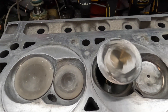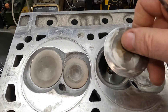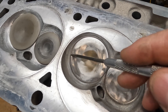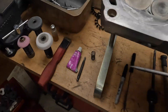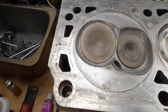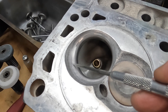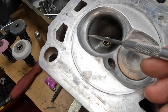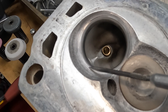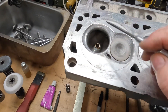I have sacrificial valves that I use to protect the seats, and I can sit there with a carbide and my arsenal and smooth out these ridges. I broke out the old valve seat grinder with the 60-degree stone and just kept going down and blending. Here's the finished one: a nice smooth transition through the 45 to the 60, no ridge anymore. There's a little bit of pitting down at the bottom but it's good and smooth, and that's going to be the final form. I still have to check all the installed heights for the keepers and see what we have to do.